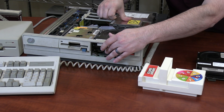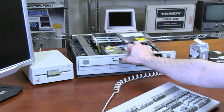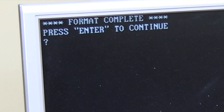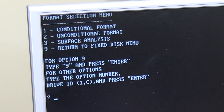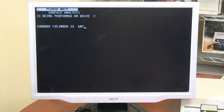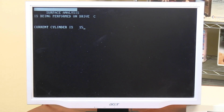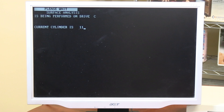It's not exactly four duds. The first drive that we had actually did sound proper, so that's probably our best bet to start with, to see if we can bring that one back. I've got a disk I made of the IBM Advanced Utilities — we used this in testing the first drive, so I figured it would be worth a shot. That's format complete. Now the question is can we do a surface analysis, because the manual seems to recommend that as the next part of the process. So far it's moving slightly faster than the first drive did. That sound it makes when it's trying to seek and gets stuck on one of the cylinder counts — it did that all the time on the first drive, and that corresponded to the nine surface errors in SpinRite 2. We're about an hour in at this point, wrapping up the surface analysis.